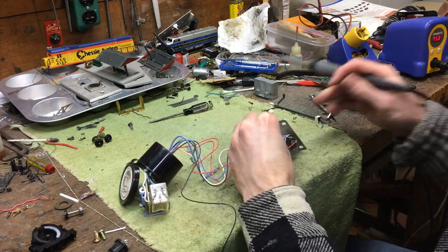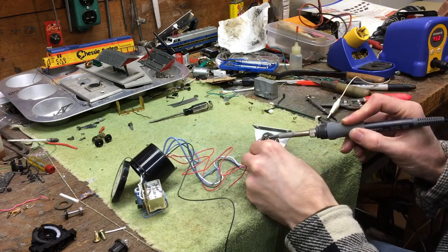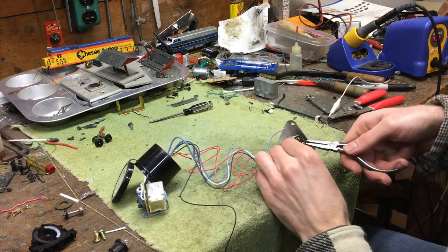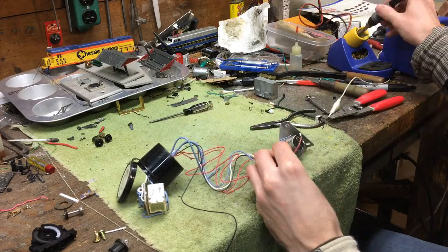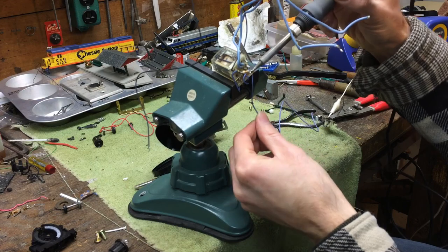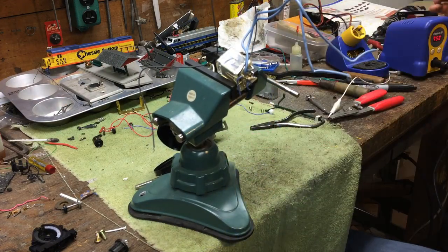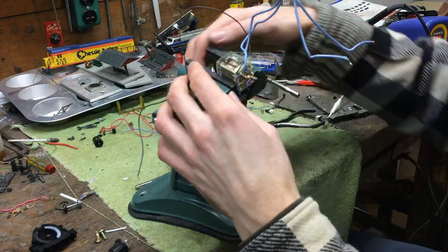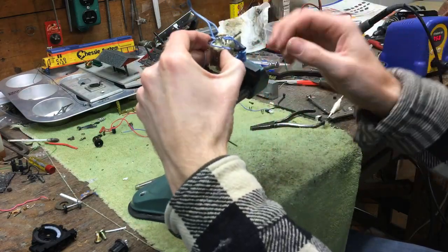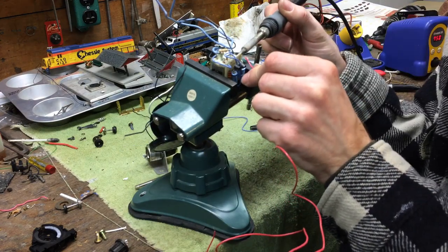What I am doing here is modifying the wiring control for a relay circuit. This originally was a windshield wiper delay control that was intended for use in old cars that only had single-speed windshield wipers. This circuit used a variable resistor which changed the voltage input to the transistors, which then changed the delay of how often it closed the relay to trigger the windshield wiper motor.